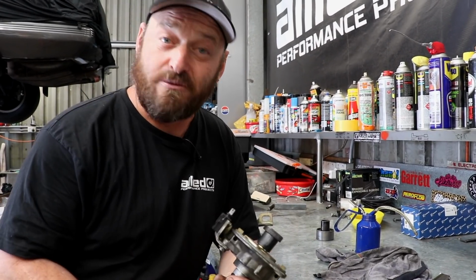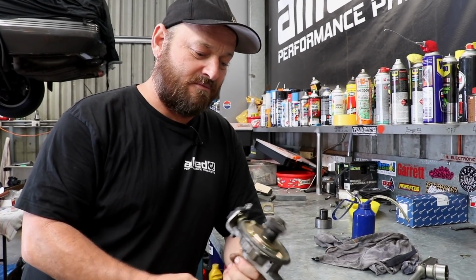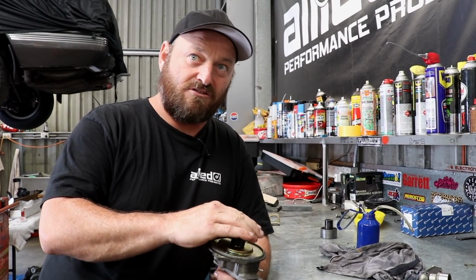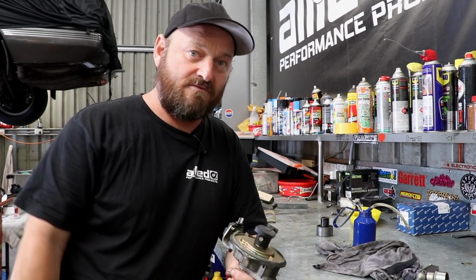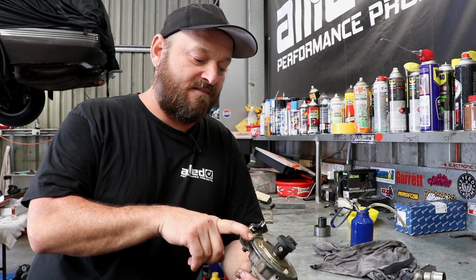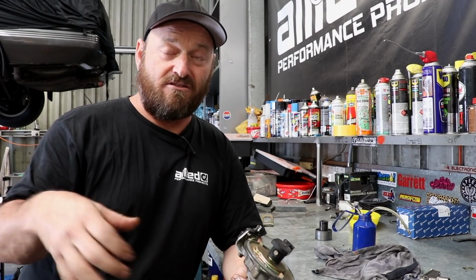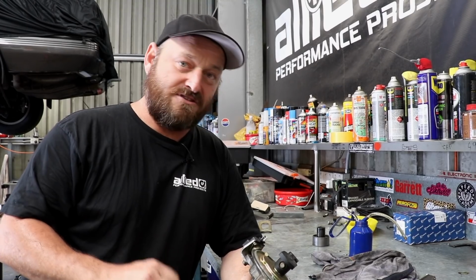Well, this is the distributor, or as it were, it's a crank angle sensor as well, so it's both engine positioning underneath here with an optical sensor, and also because it's coil and lead, single coil, it also just physically distributes. You can delete this if you get an aftermarket ECU and just use it as a sensor and put multi-cores on it, commonly done. Tom doesn't want that because he wants it to look like OG original, which is fine.